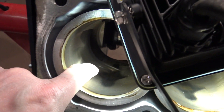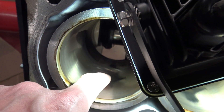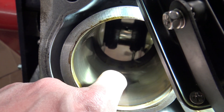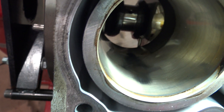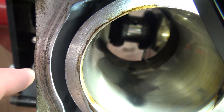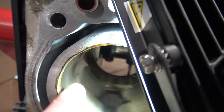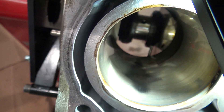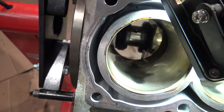This surface is so soft and plain — I can't feel anything here. But if we have a bad issue, I would feel something hard, harsh, and rough. This is the cylinder tube inspection. In my case there is this burn out on that side and in the upper area, but these sides are okay. This only tells me there is about 200,000 miles of mileage on these cylinder tubes.